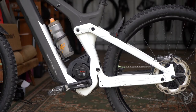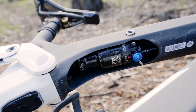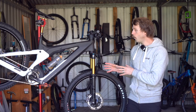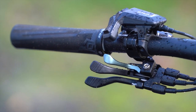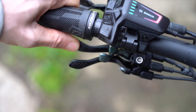It's based around a four bar suspension design with a proprietary Fox manufactured nude shock which sits inside the frame's top tube. As with many of Scott's mountain bikes, both the fork and the shock are cabled up to the Twinlock remote up at the handlebar. The bottom lever activates the dropper post while the top two levers allow you to cycle between three different suspension modes.